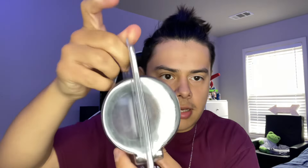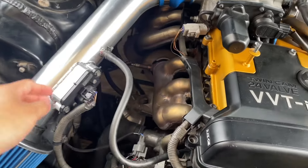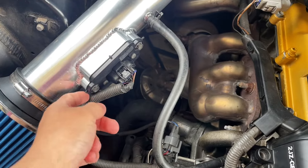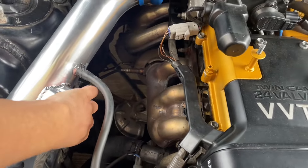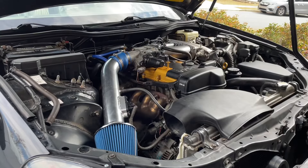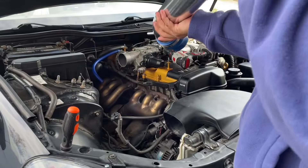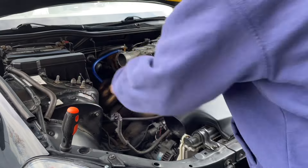So it is actually the next day. I went to AutoZone and picked up a coupler kit — it's a silicone piece that connects the intake to the pipe. I also got some hose clamps, the kind you can adjust with a screwdriver, and I paid 18 bucks for it all. Right now I'm about to check if it fits the pipe. I'm also going to deal with the vacuum leak I've been having. I'm thinking about taking this out and re-securing it because it doesn't feel secure and the gasket might be on wrong. I took it off and now I'm making sure it's securely clamped.